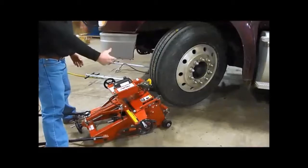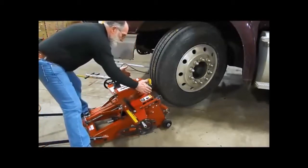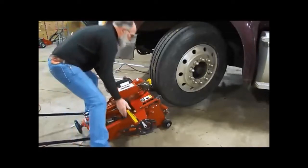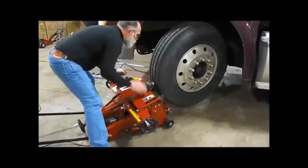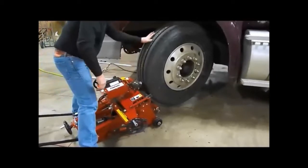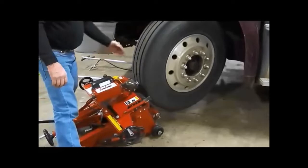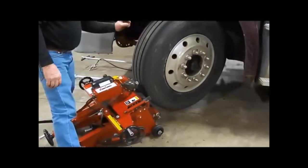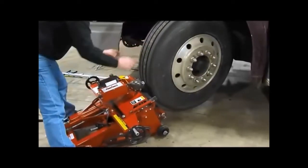Now we're going to set this machine up. We need to center the carriage in the middle of the machine, and then we slide, just work this up, pull the guide away, get within about 1/4 of an inch. You turn the tire and wheel assembly away from the blade, and that way you can see if you've got clearance. You need to have about 1/8 of an inch clearance, 1/4 inch clearance somewhere in there. Now we got that set up.